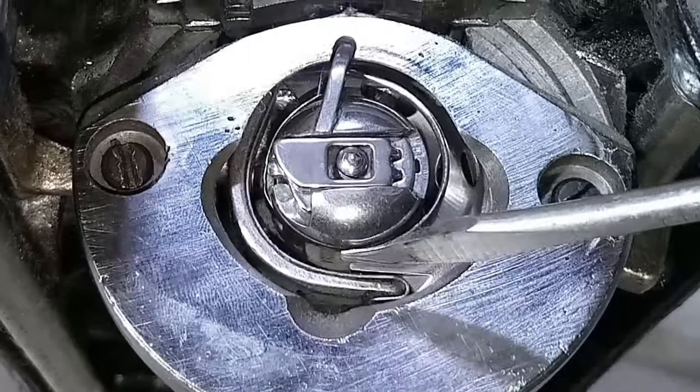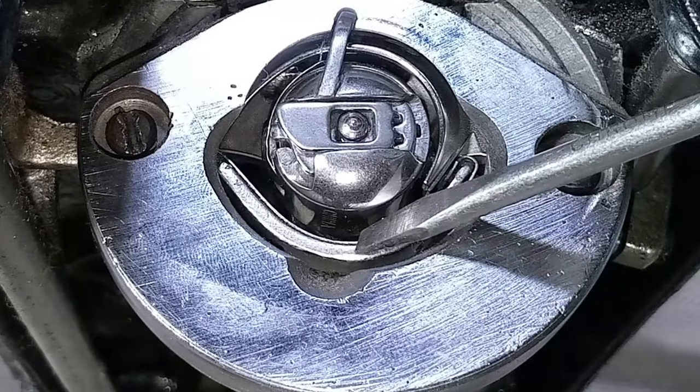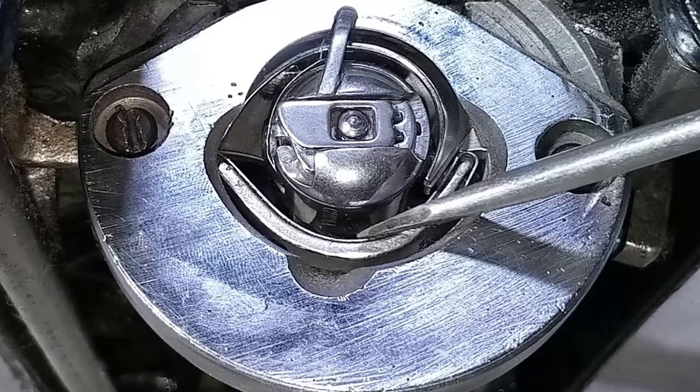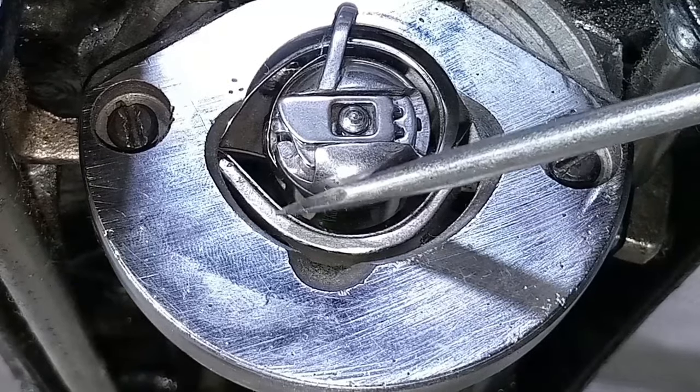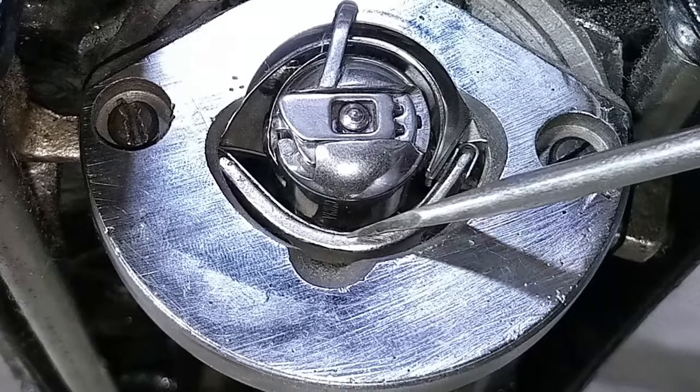It's hard to show you this from the camera, but as I'm touching this area it's pretty sharp. As the thread passes down, the shuttle driver gets thread marks — little lines and scratches — over time. This is for those who use these types of sewing machines every day.